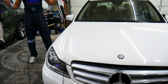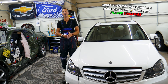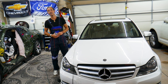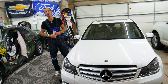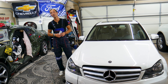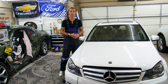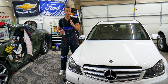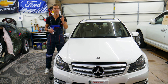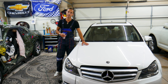C-Class, E-Class, GLE, GLC — doesn't matter if it's an SUV or a car. If you have a gasoline engine and you have an engine light with code P0420, that means the catalytic converter is below threshold — it's not working correctly. Multiple things can cause that code, but most of the time it's either a bad catalytic converter or a bad downstream oxygen sensor.